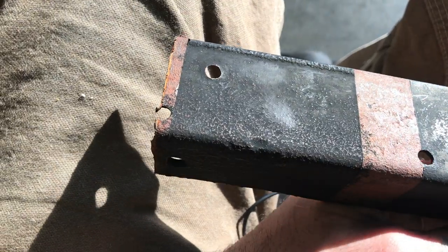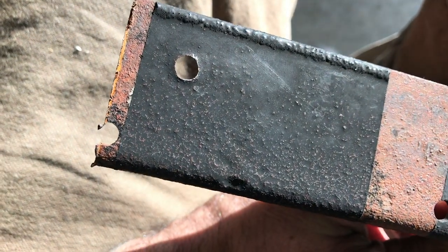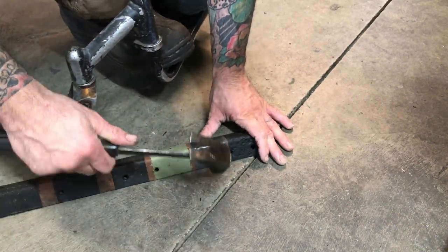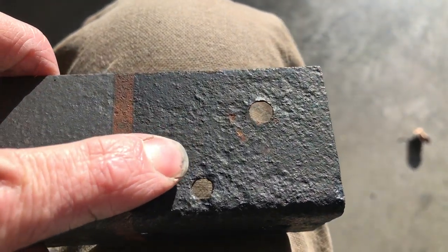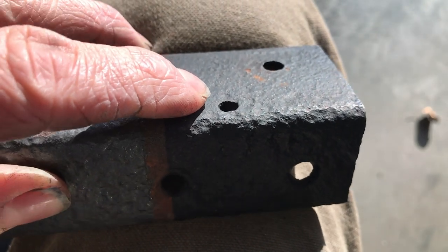Over here on the POR-15 you can really see the rust poking through. Another thing many of you pointed out was durability — how thin or thick is the paint, how well does it bond to the rusted metal, does it flake or chip if hit? So I'm going to whack each section with my trusty claw hammer, hitting it at an angle to try to get some chips to come off. Looking at the Ace Rust Stop in direct sunlight, there were some pretty good chunks that came off when hit — it doesn't feel like it's flaking, but the force does take the paint off.